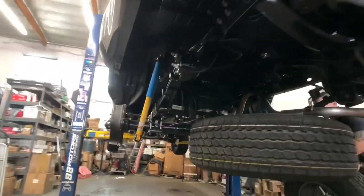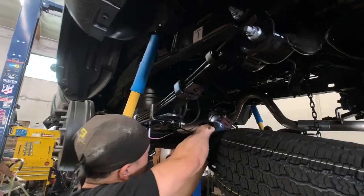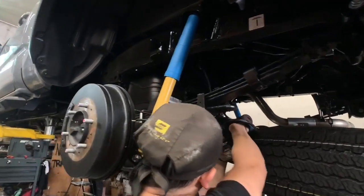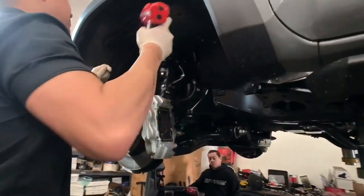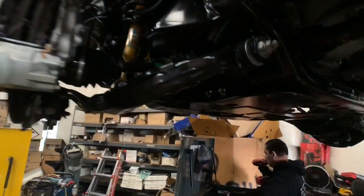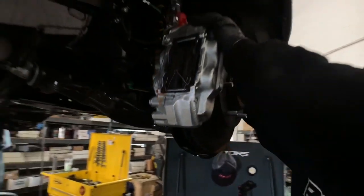Start with the suspension. We're going to be installing a King's 2.5 Remote Reservoir front coilover adjusted to about 3 inches of lift height, along with some CAMBURG tubular uniball upper control arms to maximize articulation and to correct the alignment angles after the lift. For the rear, we're achieving a 2-inch lift with the Dakar EL095R full leaf pack.